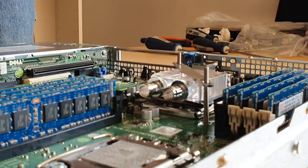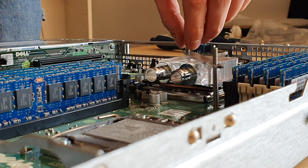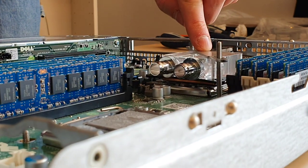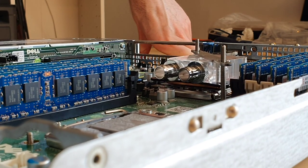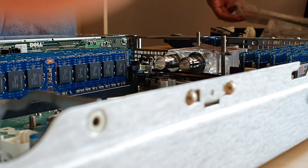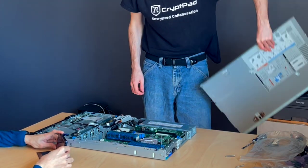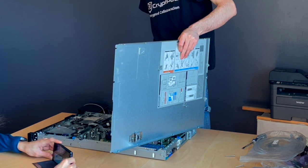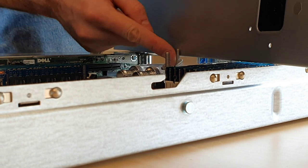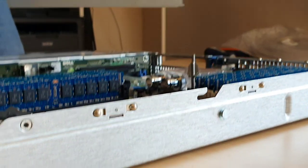And it's too tall. So because it's too tall, we're going to need to cut these bolts. But we're going to need to fit everything exactly right before we cut the bolts, because we need to cut them at exactly the right height. This is almost impossible to do. The height here is, we're right on the edge. We take a straight edge, put it across here, and you can see there's very little space to go on. You only got this much space, and this is what we're going to have to cut off the top of these bolts in order for us to fit.